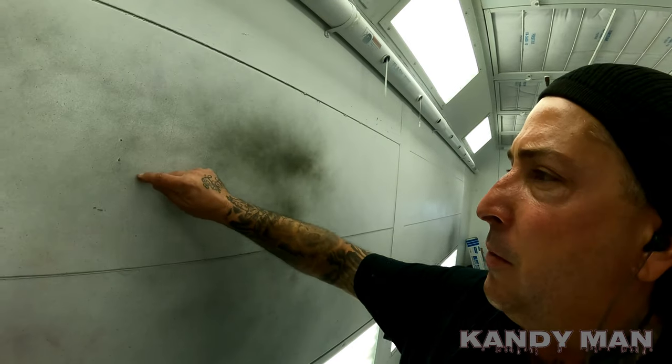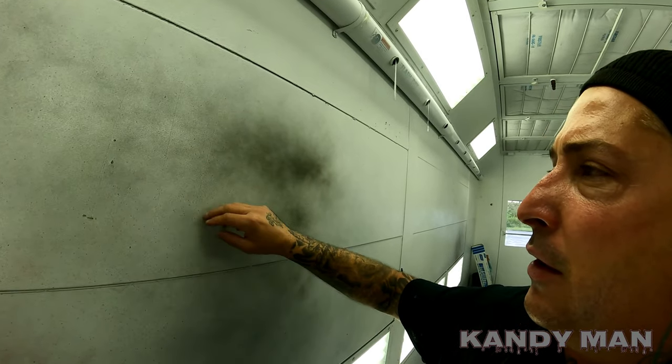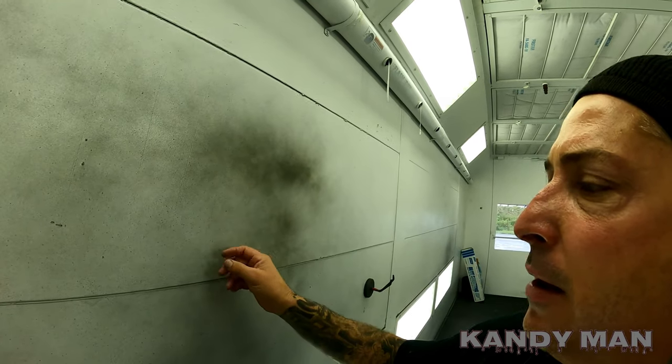And if you don't have the money for that, get some other filters in line and make sure you drain them out. And also, one of the things you could do is, when you're running your pipes, run your pipes up, come down and have a little trap on them. You could put them going up and down and have a couple traps on your filters. That way the water will settle to the lowest point, for you guys at home that are trying to paint stuff.